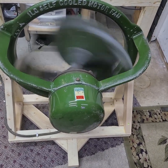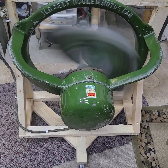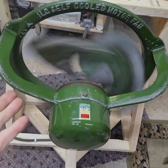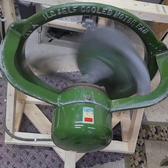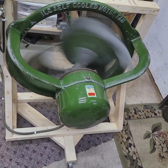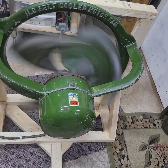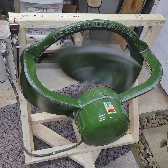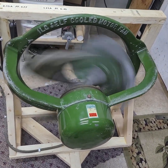That other fan runs at about 700 RPM on low speed and 850 on high. So there is a difference — this one is 550 on low versus 700. You can kind of change the low speed a bit based on what size capacitor you have. You could probably make a dual system where you have two different capacitance sizes for the two speeds independently.